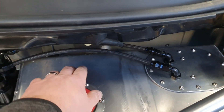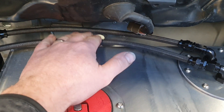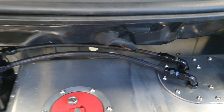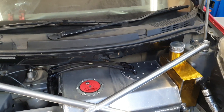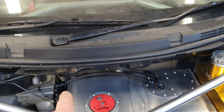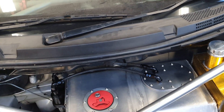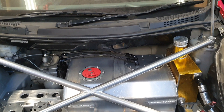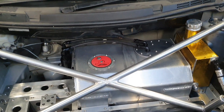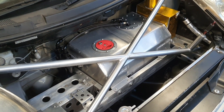I talked about putting a bracket here with a clamp to hold the hoses, but they're not going anywhere - they're pretty sturdy and strong and stiff enough, they'll hold themselves there no problems at all. You don't go dead straight line between there and there because if something gets a knock it'll pull the hose and break things, and then you have a fuel leak and the fiery burny stuff gets out and makes hot orange things that melt everything and hurt people.